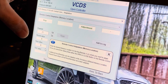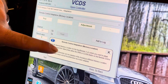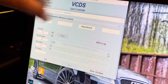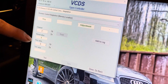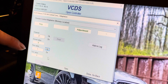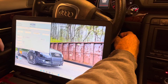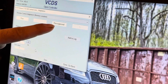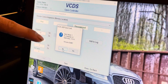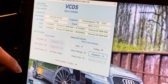The stored value is zero because you have no keys in the memory for the car. Wait for the pop-up — it gives you a walkthrough on what to do, but it's a little funky. Just close it out. Your new value is going to be how many keys you want to program. Since we want to program one key, go up to one. Once it's there, hit the unlock or lock button — either one — and hold it. You'll notice it just went to 'recognized.' Now that it's recognized, hit Save and confirm yes.